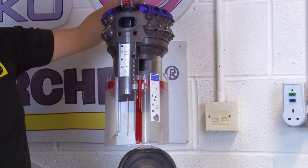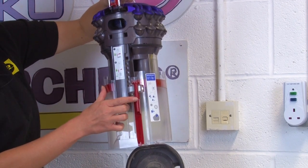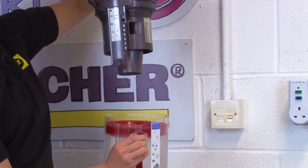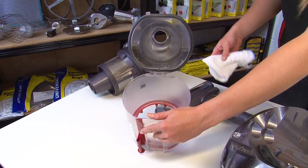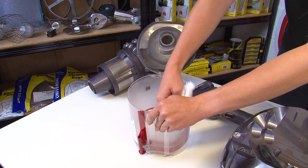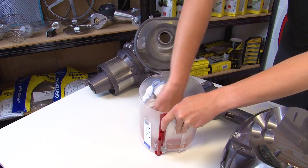You can also clean the inside of your bin to be extra thorough. To do this, pull the silver catch behind the red release button, then slide the bin clear of the cyclone. When cleaning the bin, only use cold water and a cloth. Don't use hot water, cleaning products, or any appliance such as a dishwasher or washing machine, as this could damage the bin.